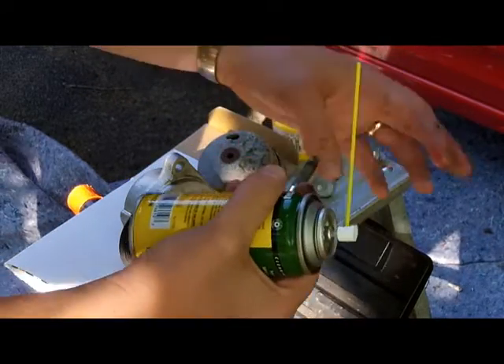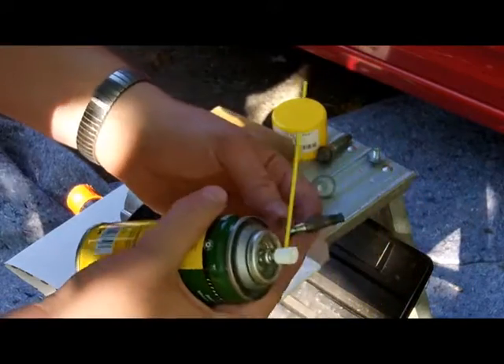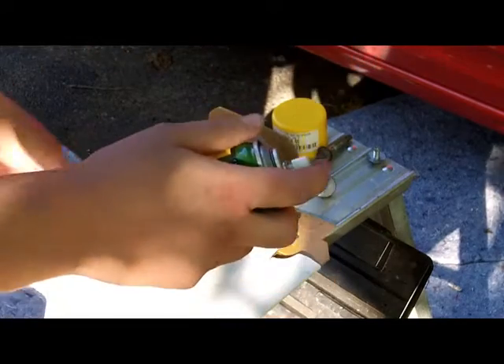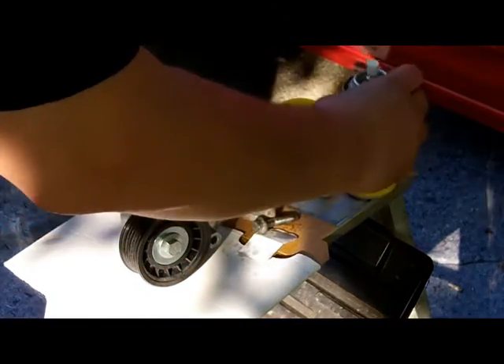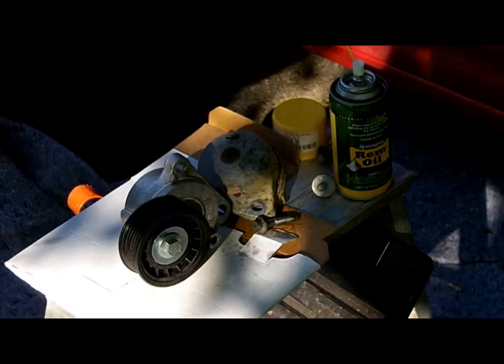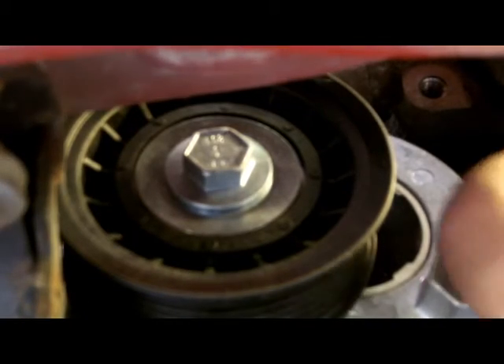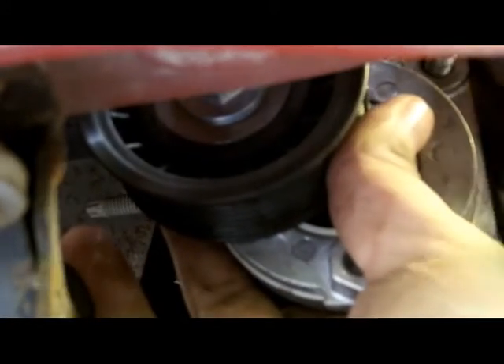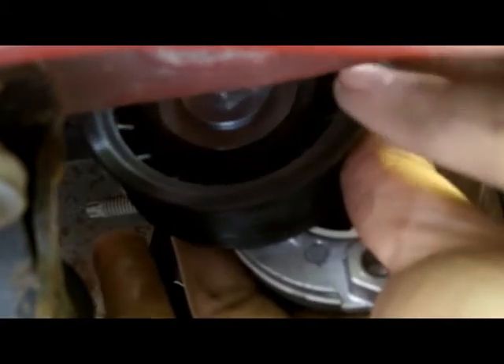I've got the new tensioner on the left and the old tensioners on the right on the ladder, and you can see they're of different manufacturer. If you find your tensioners bad you'll have to replace the whole assembly, not just the wheel — if the wheel goes bad the whole tensioner has to be replaced. So let's slip it back up in place — you see the two bolts, one at the top and one at the bottom, both on the right side as you face it, towards the front of the vehicle.